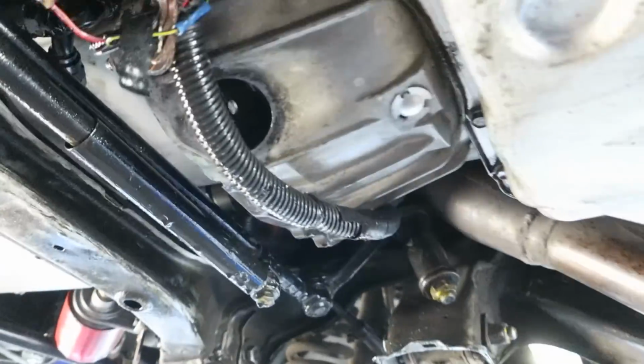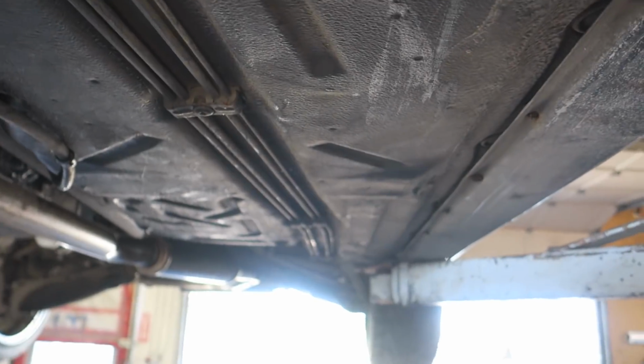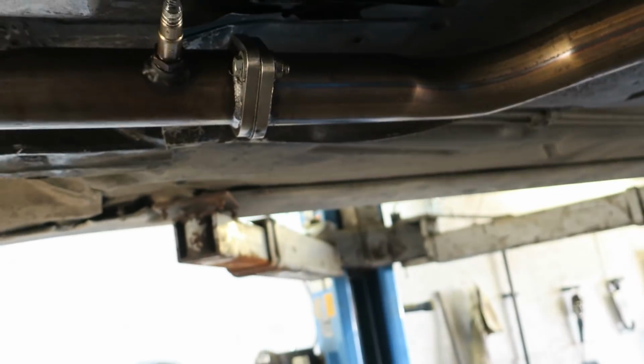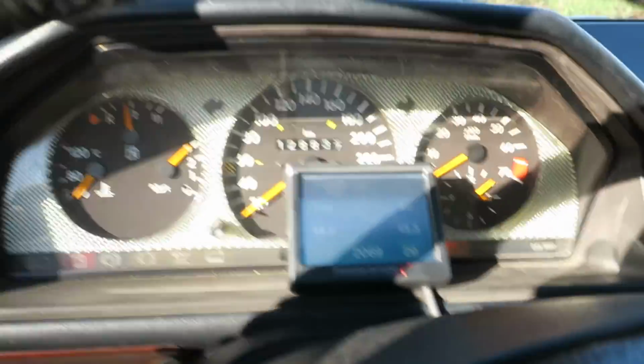Definitely got oil there, and that is either these fittings right here or valve cover gasket. We'll have to take a look. Yep, that was the culprit. That one was loose. Tighten that back up again. Thanks to Toosley here. Nice to pull in on your test drive and fix it before you go home. Oh, I know what the noise was. Speedo quit. Oh, that's what the clunk was. It's going to the training shop next anyway. All right.